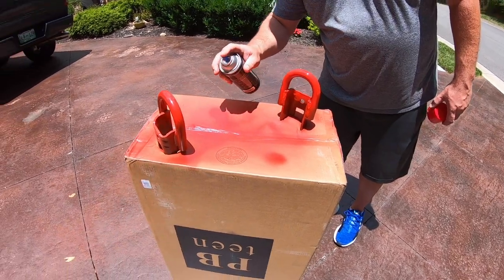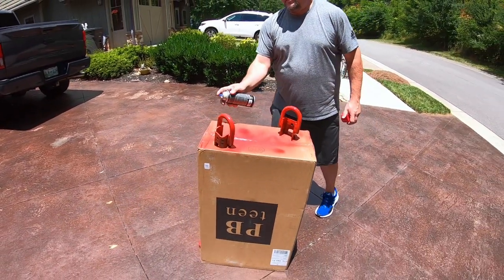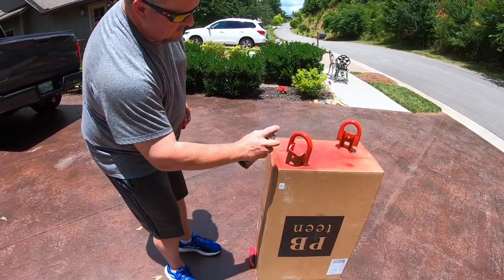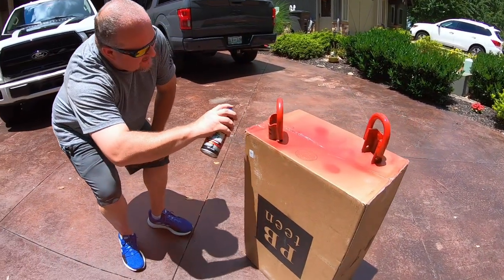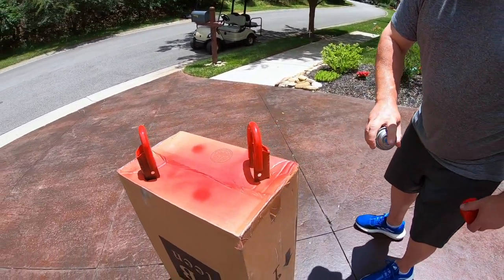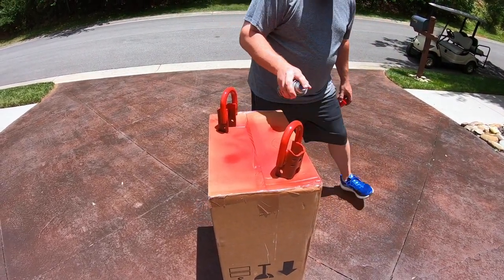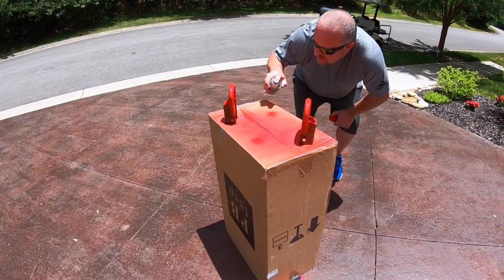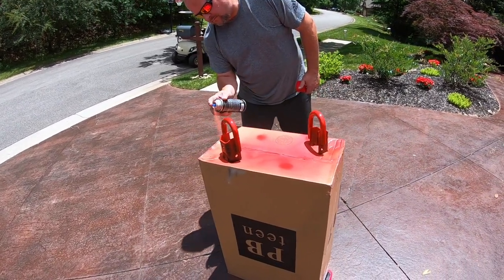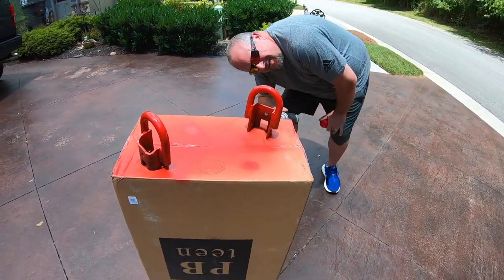It's pretty good painting, Sam. In case y'all didn't know, Sam started painting when he was about four or five years old, painting out panels from his dad's sign company. We'll tell you more stories about the old sign company someday. We've been around paint a lot but Sam's really good at it. This coat's looking freaking sweet. The good thing about using enamel paint is you don't have to use a clear coat. When you need to touch it up later, just hit it with light sandpaper, tape everything off, and hit it with a little paint — it'll bond right back on. No worrying about removing clear coat and reapplying.